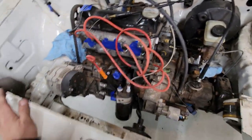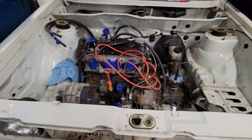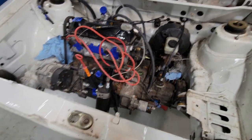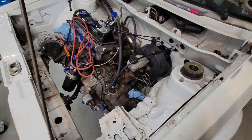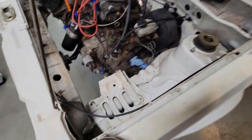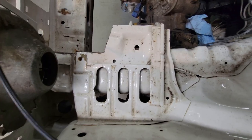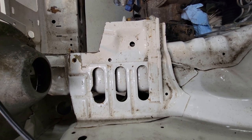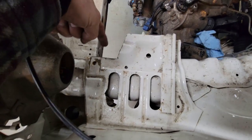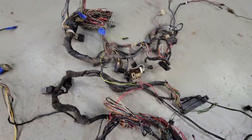Stay tuned, there is more to come. I'm just trying to get everybody caught up to speed, because I got several hours into this before I thought maybe I should film this, because some other people might also be living in hell with a Mark I with an ABA swap. Also, if you're going to do a Mark I ABA swap, don't cut the battery tray. Just drill the spot welds and take the damn thing out if you're going to modify it. Because this — this is crap.